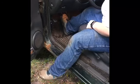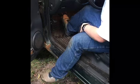Now you come to the truck, or your vehicle, whatever you have, and I'll start it up here, and we'll make sure our lights are working. So you take your key, start your vehicle, turn your four ways on, and you walk back to the back of the camper. If your four ways are flashing... I can't tell if that one's working, but this one over here is working. So we've got one over here working. This one over here seems not to be working.